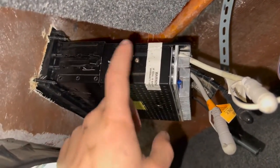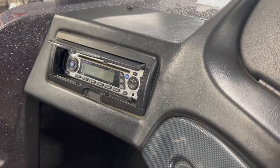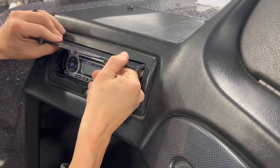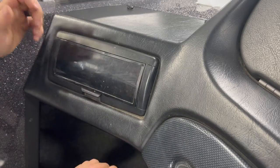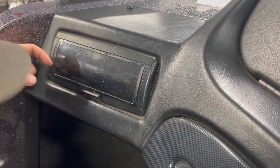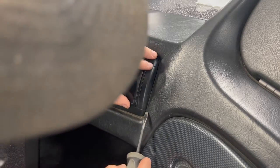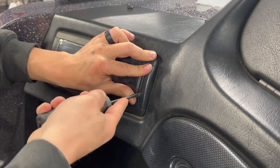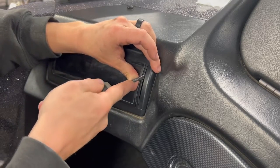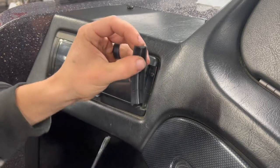So now we're ready to actually pull the old radio out and get the new radio slid in. This part of the process is very simple — what we're gonna do is go ahead and remove this entire outside housing here. This is kind of a waterproof deal — or water resistant I should say — it's got a little door that shuts to keep the elements off. The first thing we have to do is pop these two black caps off. We're gonna go ahead and try to be very careful, the tabs are on the ends and we don't want to break this because we do intend to reuse it. These should come off fairly easy but things get brittle, so just go real slow and work them off like that. There we go — there is one.